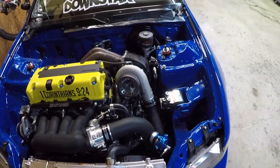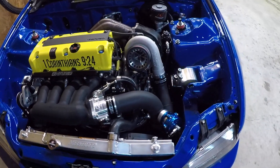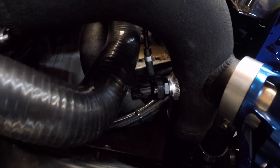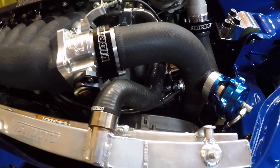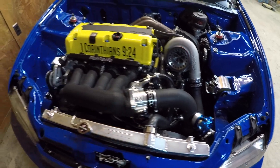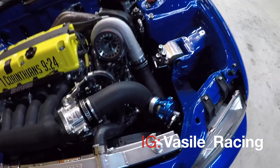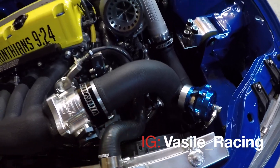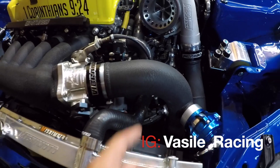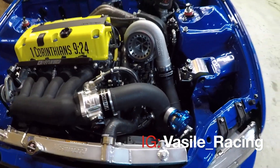So let's set up here — K20 turbo, Precision 62/66 — and what we worked on is the intake air temperature sensor right there. My buddy Travis did awesome work with that fitting, the compression-type from Ktuned. I'm kind of excited — it came out really good. I think that's a really great spot right there, and if you guys turbocharge your car and decide to run it the same route I did, that's a very good way. It's kind of nice and tucked underneath the radiator hose — not above the hose, maybe a little bit lower than anticipated — but you have to be on a straight side, can't be on an angled side. K2 for the win.